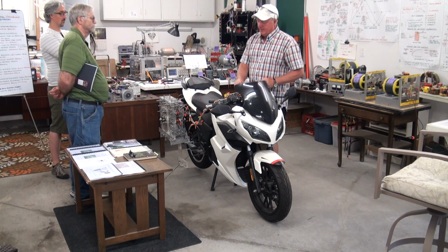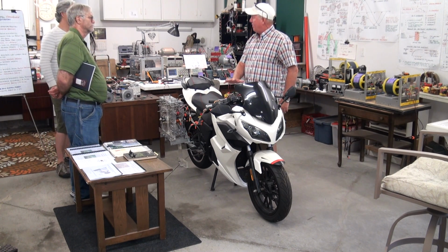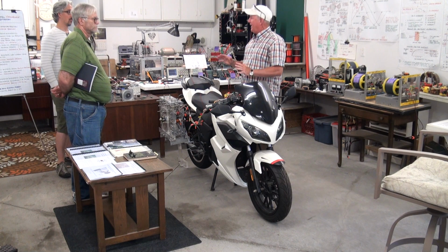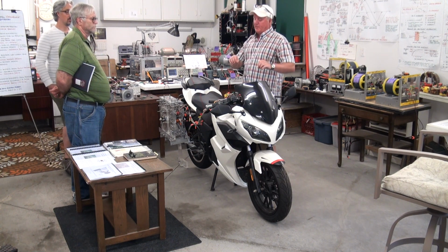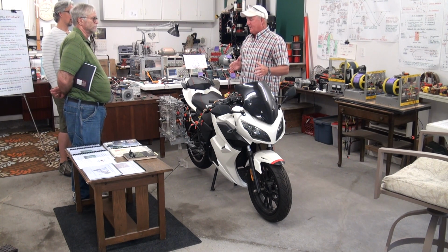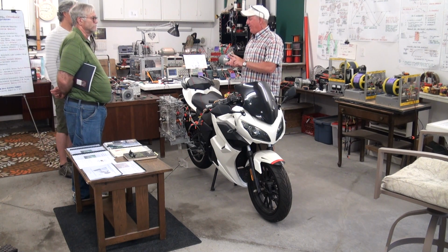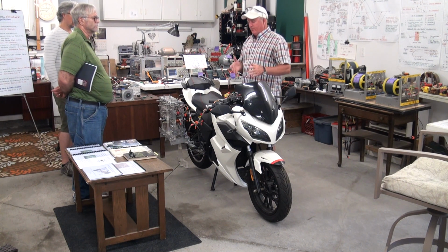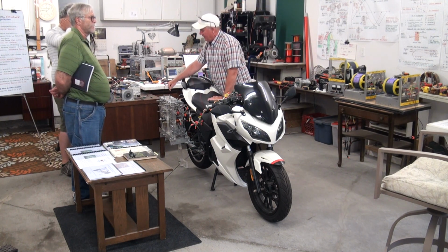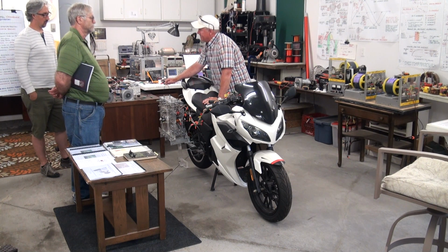what I'm going to do here. Through playing around, I've found that if I have one quantum motor coil in motor operation and these two, it seems like I get the best performance right now. So that's what the CPU is going to be basically deciding once this is in an EV. Number one, what's the driver input? Number two, what are the road conditions? Number three, what's the best operation for the coil under these conditions? Not just the coil, but each individual coil, and then the combination of all the coils.